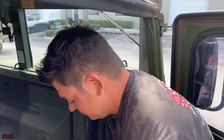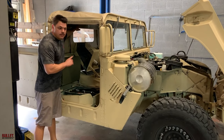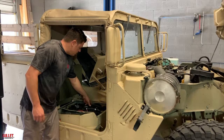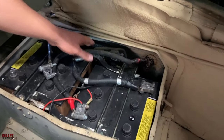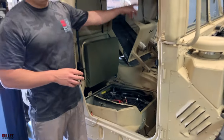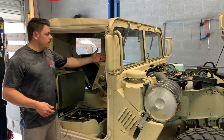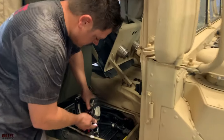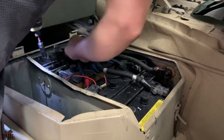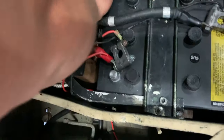Let's go ahead and solve this problem. This truck has an aftermarket stereo — a Wet Sounds AS10 bar. I've already checked this to see if it's pulling amperage — it's not. So the next step is to go to the starter, because the power comes from the batteries, goes to a distribution block with a grounding block and then your positive stud. We're going to first clean up the terminals here, then go to the starter because the starter webs out to all these accessories and the ECM. I'm going to take the battery hold-down off with a half inch and pull off the crossover cable.